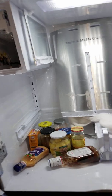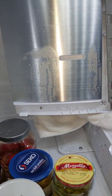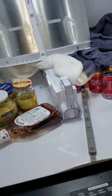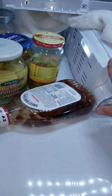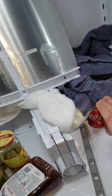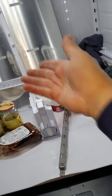To take that out, we obviously removed the shelving first. We took this little piece here — it had a screw in the top and a screw in the bottom, which are the longer screws. Then there were two shorter screws, one here and one here. In order to access those, we also had to remove the bottom shelf. There are two tabs that have to be pressed simultaneously, one on each side of the filter housing, while picking up on that shelf. Then you slide the whole shelf out of the refrigerator, which gives you access to the back panel.